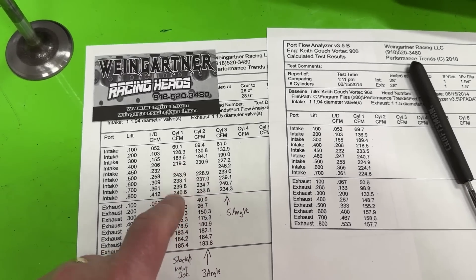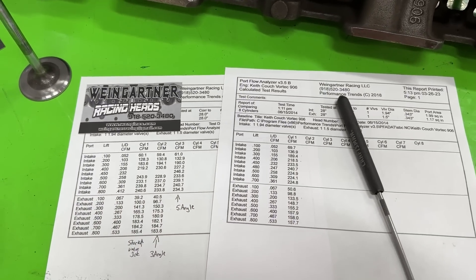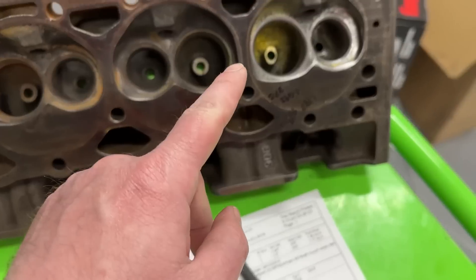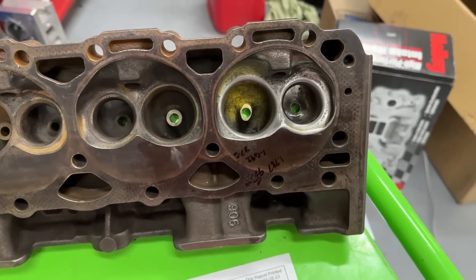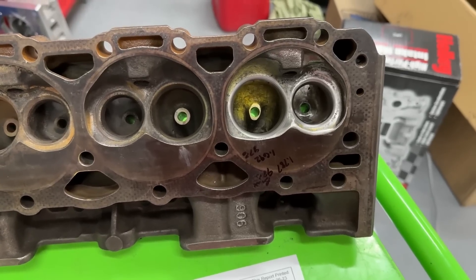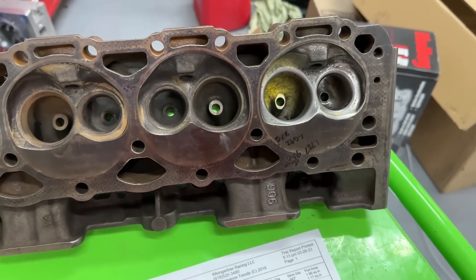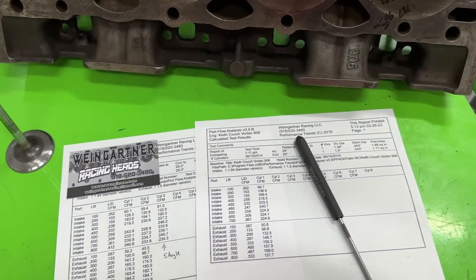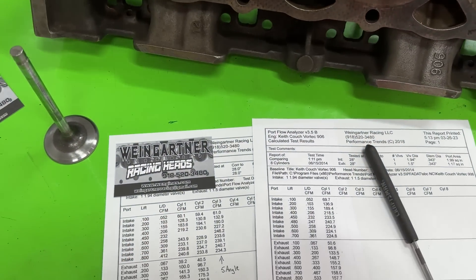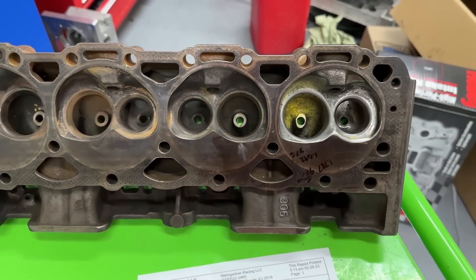Either one of these valve jobs is going to make more power than the starting point. So now you've got some answers on how much a valve job is worth — three-angle or five-angle. Don't think all five-angle valve jobs are the same, because this is my most mild one. I've got some that are way more aggressive and will remove more material, and if you blend them they will flow more air. It's about not only the angles, but how wide each angle is — especially the top cut. If you're porting Vortec heads, the most important thing you can do is the valve job, which is proven right here. Then you can get your grinder and go to work. Thanks for watching, guys — take care.